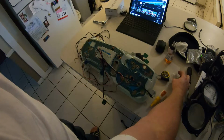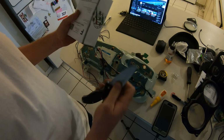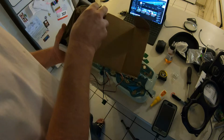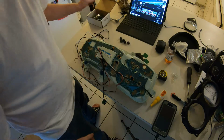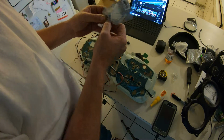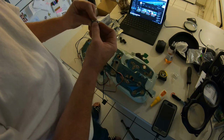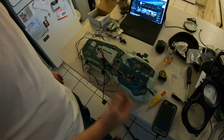So I said we were going to dump the standard bulbs. These happen to be a 168. I'm going to put these LEDs in there. I usually get my LEDs from superbrightleds.com. These are far more expensive than a bulb, whereas these are probably around $5 a piece, but they're way brighter and they'll last, I don't know, way longer. These are 360-degree beam, and they're 5 LED. I got them in color cool. They seem to be the brightest. These are the push-in style. And that's it. We'll do it for all 5, and then we're gonna get to installing this.